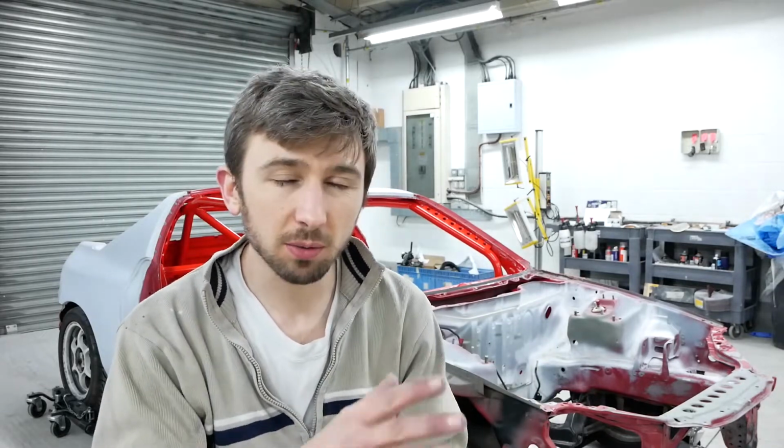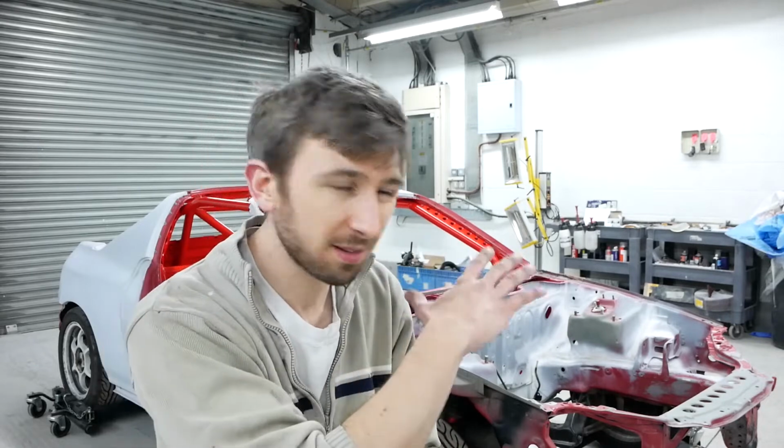Mikhail thinks, and I probably agree with him, it was reacting a little bit on the etch primer, where the etch primer was really heavy, so just localised places where it was pickling up. So we had to do a couple of flashes off in between the base, going in with some 500 grit, sanding down where it was reacting. Mikhail threw a bit more aerosol primer on, and then on with the base again. Eventually we managed to get it to sit really nicely, and then on with the clear coat, which again went on absolutely fine.